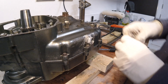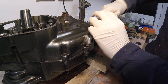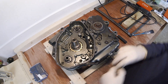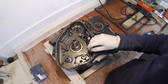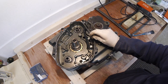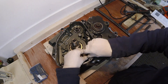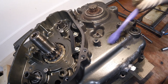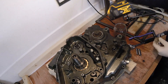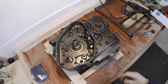I've already undone the others so this should now just be a question of them coming apart gently. They're all loose. You'll also notice that there are bolts actually inside the casing as well — one here, and one, two, three, four there, and another one there. Two of the larger ones and one, two, three, four smaller 11mm ones.